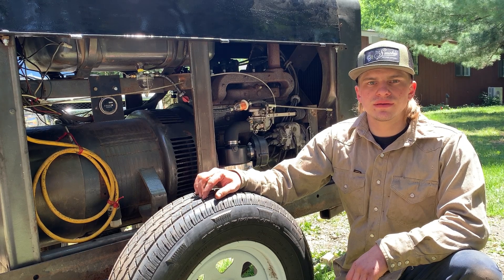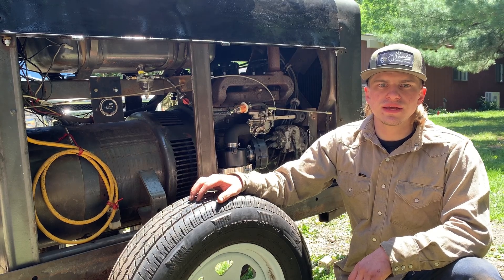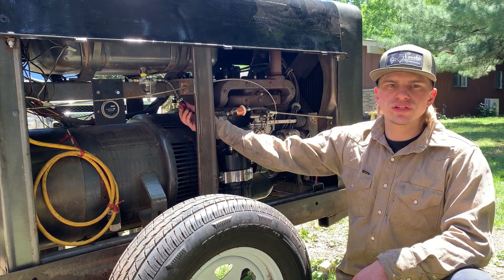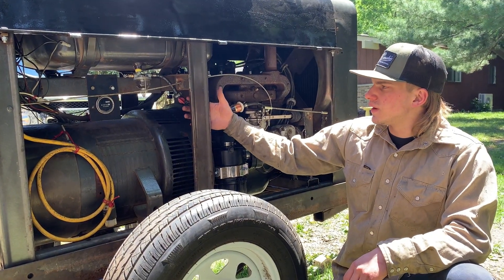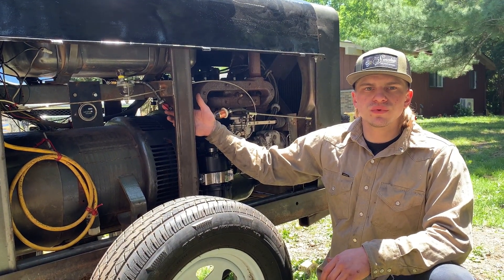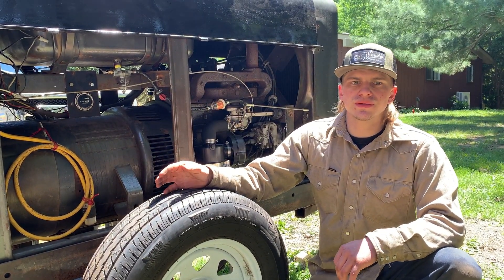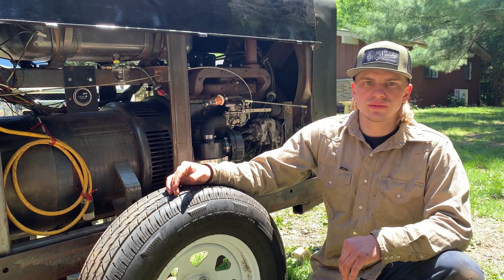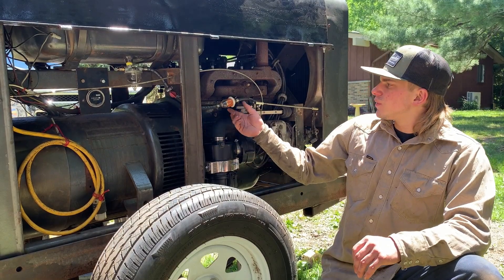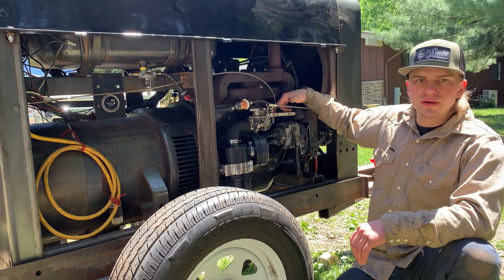Red Coat is pretty much the only fuel tank sealer I would recommend — it's the best, and it's guaranteed to not flake or chip or get into your gas. I've also replaced the fuel line and put a fuel shutoff switch right here. If I'm only going to use the machine once a month or once a week, I'll shut the fuel off every time I kill the machine. Doing that will prevent the carburetor from gumming up from the ethanol in the gas. I've also put in an inline fuel filter here with a couple of hose clamps going into the carburetor.